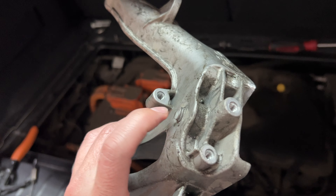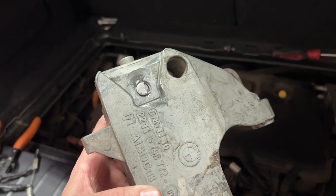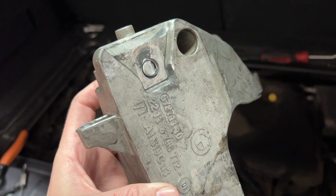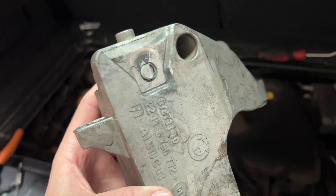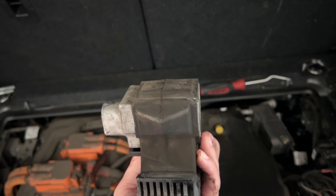Customer wanted to approve the repair, so we're doing it. We got the mounting bracket out — this bolts to the engine and also to the motor mount. You can see the bolt that sheared off in there. Online it's a common issue; it's the first time I've seen it. I worked at the dealer for many years and this is a first for me. No sense trying to get this bolt out — it's wedged in there pretty good. It's a hardened bolt and this is aluminum, so it's better just to replace the whole piece. There is an updated version of the bolt, probably because this has been happening.